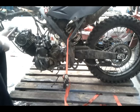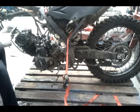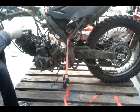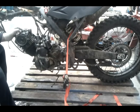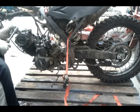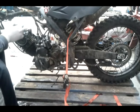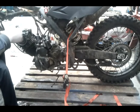One heck of a muck around once you've done that. That's why I've got a big bolt in this one here. So I've had to re-tap it. There wasn't enough room to tap it, and it's not that strong, so headache. So I would only torque them down to about 30 newtons, 35, anywhere past that. If you got a cheap Chinese engine, the metal might be weaker like mine and it'll crack, and it's just headaches for a week just mucking around and a week without riding.